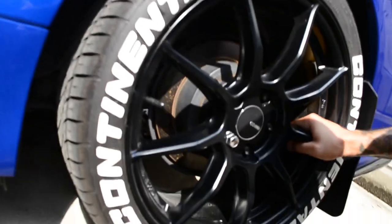Got the car jacked up. It's always good to crack your lug nuts loose before you jack the car up — the back wheel doesn't matter so much because you've got an e-brake, but the front will spin and it'll be hell. I'm doing one side at a time because my jack doesn't reach the diff in the back to do the whole rear at once. The diffuser in the back makes it hell to jack up the car, so just do one side at a time.